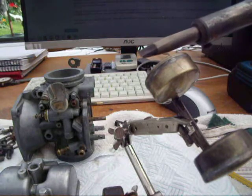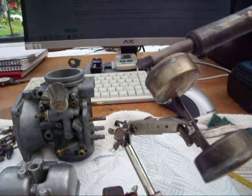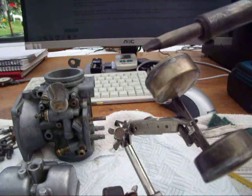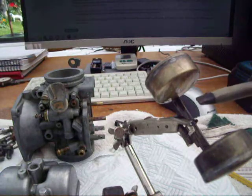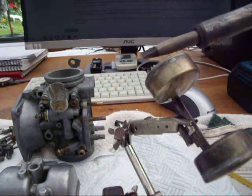These quite often get damaged when you're handling them or when you're cleaning them. If you press them a little bit too hard the floats can go concave and they pop somewhere. They're very thin and they do wear. What happened on this one was the soldering in the centre there that seals the cylinder actually popped and started to leak.